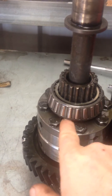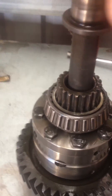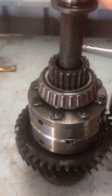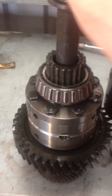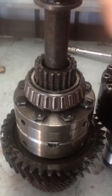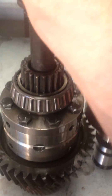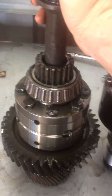One size fits all — there's two selective shims in here, one there and one in the bottom under there, but they soon wear out. Also, people don't use the diff lock lever. On the gravel do whatever takes your fancy, but anything more than that, always push that lever to the left and engage that center diff lock.